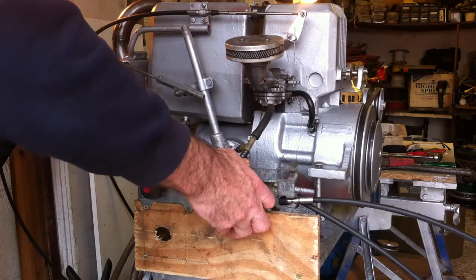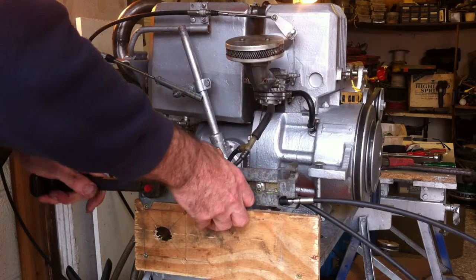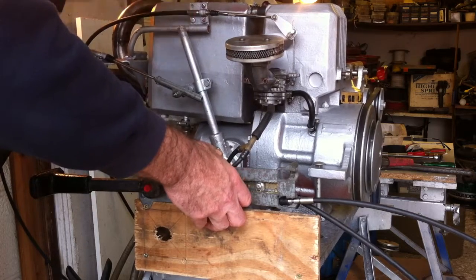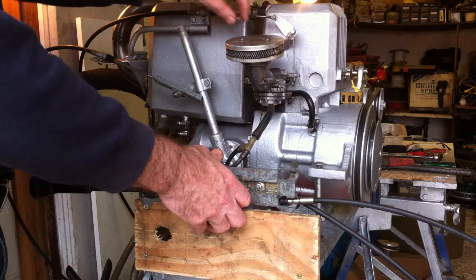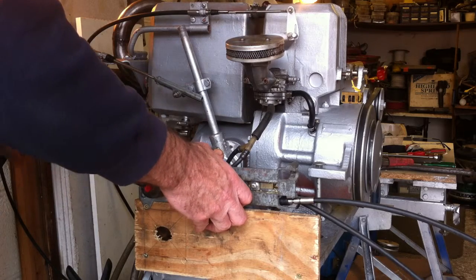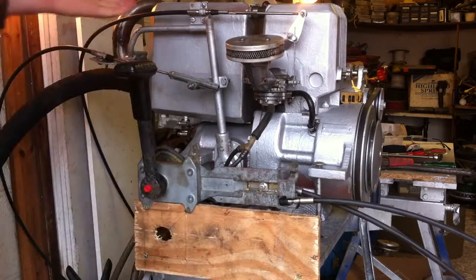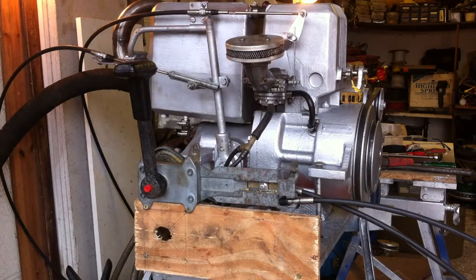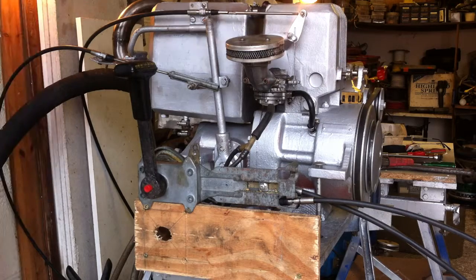So here we go. Back it goes, and now a bit further, the throttle comes on. There is a tiny bit of movement here — that's not a big problem, because you don't run for long in reverse — but you must have a bit of slack in forward gear when it's running, just to make sure the selector fork isn't under strain. And that's it. That is how to do your Morse. You could have a more flexible link in here if you've got any doubts about the strain, but that's as simple as it gets.